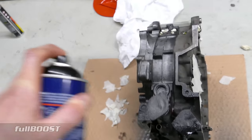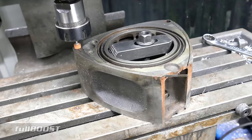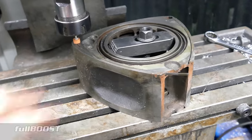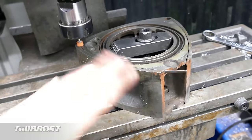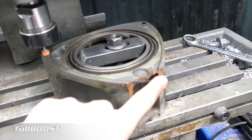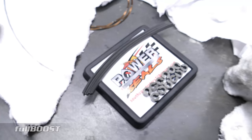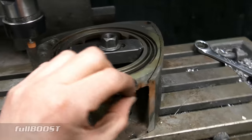Get some colour on there. Obviously one of the last parts before building the engine means making sure all the little seals and whatnot are right, marked up to spec, and all the tolerances are correct. Side seals are one of the things that will need to be machined to length quite a lot because the PowerSeal ones do come oversize, so you can make them fit and do your own spec tolerance the way you want it.